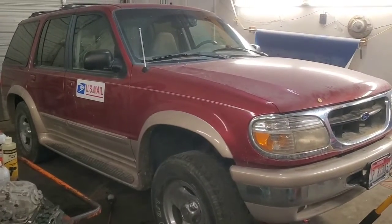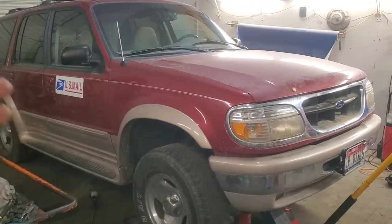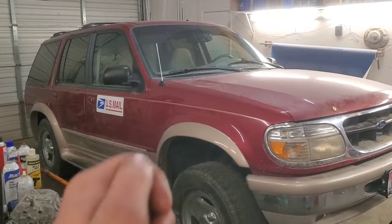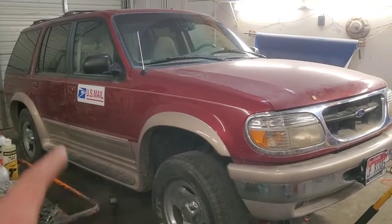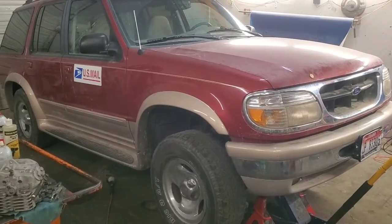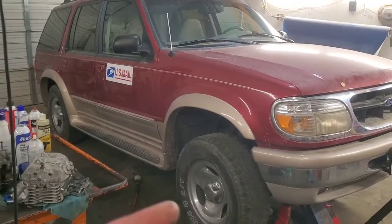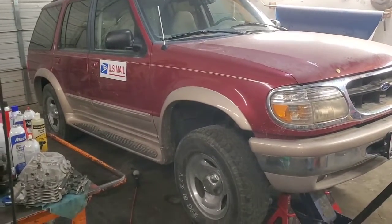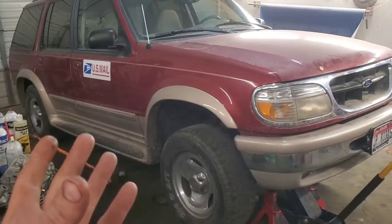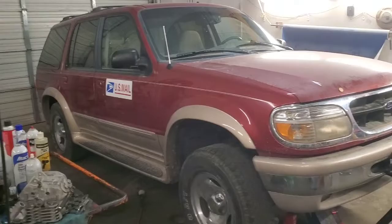That's similar to shift-on-the-fly systems in pickup trucks — you should not engage four-wheel drive while spinning. The 1995 and 1996 Explorers, which I've worked on quite a bit, have two-high, four-high, and four-by-four low but no auto setting. That's how this auto system is supposed to work. For stop-and-go use needing four-wheel drive, you're better off locking it in four-by-four high, which locks those magnetic clutches in place.